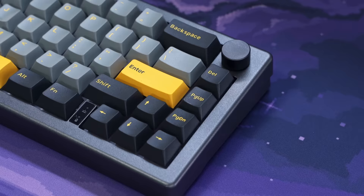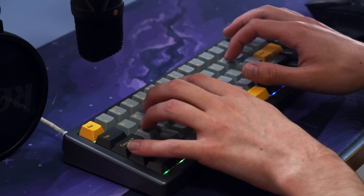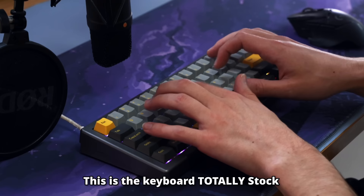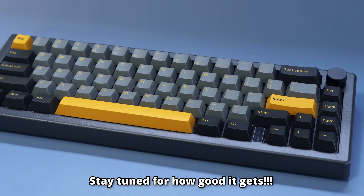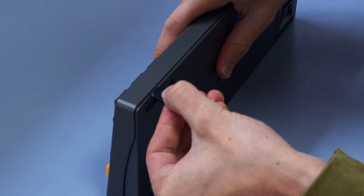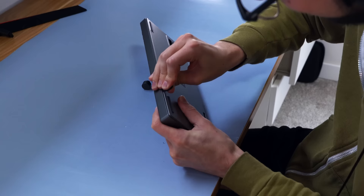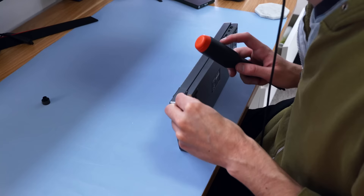Having those on a pre-built keyboard that's under $100 is relatively nice. Because they're double-shot PBT, they're going to sound a little bit clackier than a die-sub PBT keycap, or a thocky SA keycap. But with the RGB going, this black and gold color profile is very pretty. It's been five minutes and there hasn't been pillow foam — but let's set a baseline. Here's what the keyboard sounds like before any mods. It's not perfect, but it's pretty decent. The switches have a little bit of ping, and the case sounds a little bit hollow, which we're probably going to fix. There's still one core problem, and that's I don't know how to get the case open. I know you need to take off the knob, and there are literally no screws, so the only thing I can think of is forcing a guitar pick into the case. And here's where this keyboard gets a low score on the modability scale — maybe like a 3.5 — because anytime you have to essentially damage your case to open it, that's what we call bad.